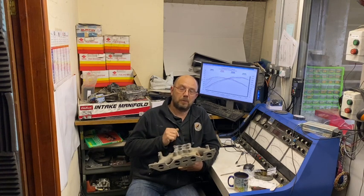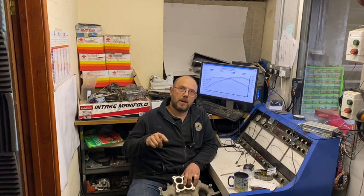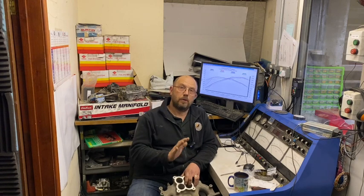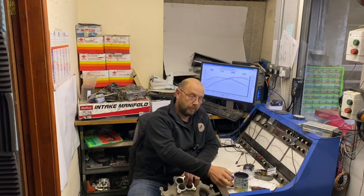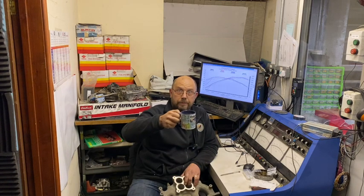But I still only think by a negligible amount. Now there might be those amongst you wondering whether the engine is actually up to it — can the motor deliver? Well, just to answer that, I'm going to add to the graph a dyno run on the same engine on the same day, but this time with the 45 DCOEs. And you'll see a considerable jump in power. So clearly, had the four barrel Holley been able to deliver the goods, the engine would have made more power. And on that bombshell, I bid you goodnight. Catch you next time.